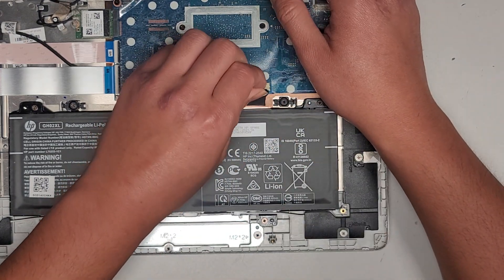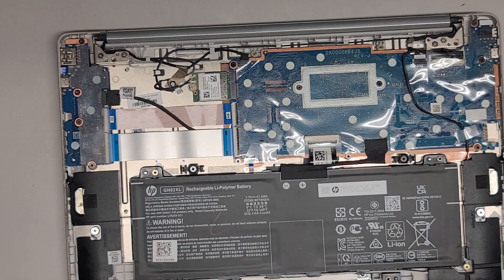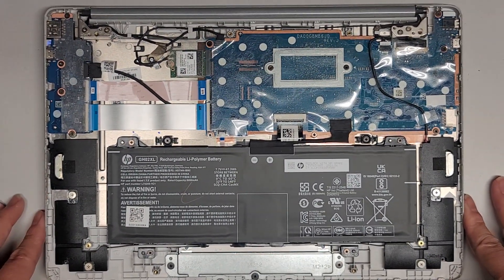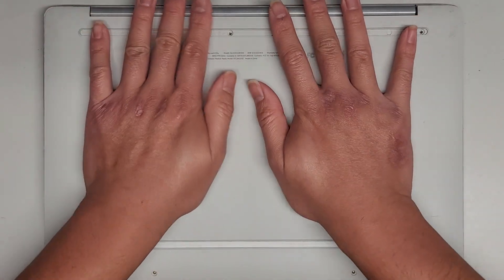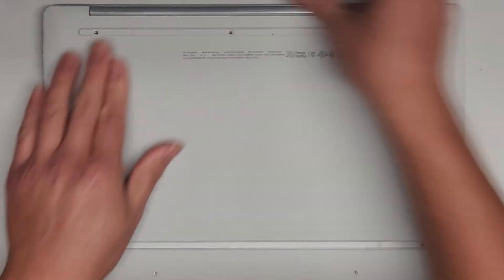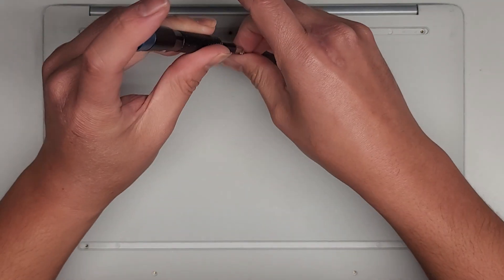Let's go ahead and plug the battery back in. If it doesn't work, it's a motherboard issue. Actually — the battery charge light is now flashing, which wasn't happening before. That's a good sign! There's no RAM or SSD to upgrade on this model, so we're just going to pop the bottom cover back on, line it all up, and click everything back in. Then get all eight screws back in.